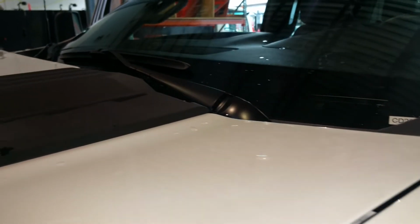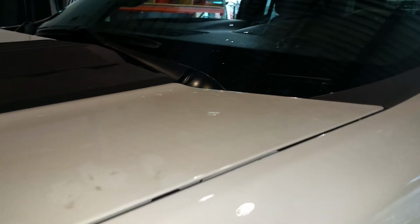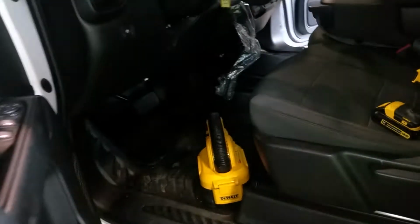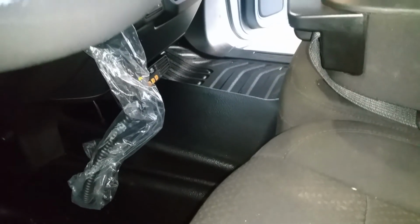So it's designed for this type of extra cables when compared to other cars like Ford, where you have to cut one side, the other side of the big fat grommet. So that's the antenna. It takes you some time to run the cable nicely and use some insulation split loom, because there is some heat around the engine, and over the years of use, the antenna cable coaxial insulation will get damaged, will peel off, or might get harder.